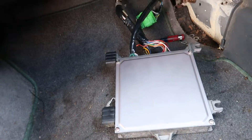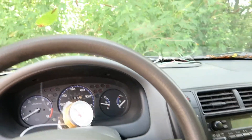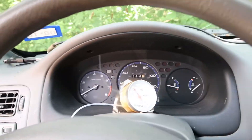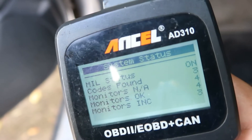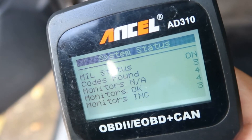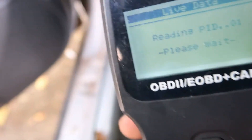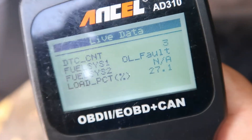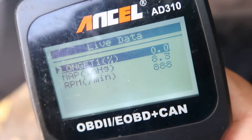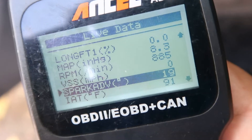I have the OBD1 unhooked and the stock OBD2 plugged up. Going to start it and see what kind of data it shows as far as factory timing. It is a cold start. It threw three codes — I'm surprised it's not more than three with everything done to this car. Going to go to live data. We're trying to find some timing data — spark advance is showing 19 degrees.